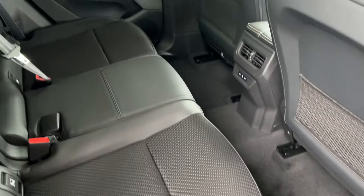To start the car, push the brake and press the start switch. When it says 'ready', you can drive the car. There are buttons down here: one for cruise control, one to switch off traction control, and one for the lane keeping system. If you get the 'lane keeping not configured' message, please watch my video on how to fix this. Below that is the electric hold function. This button is your handbrake — push the brake and push this to release the handbrake. Pull it to engage the handbrake, and you'll see the handbrake light on the cockpit.